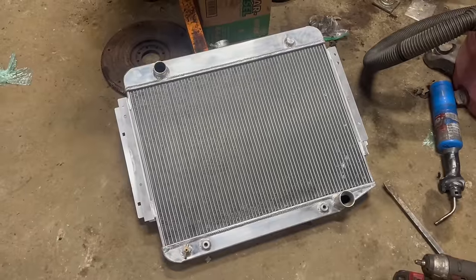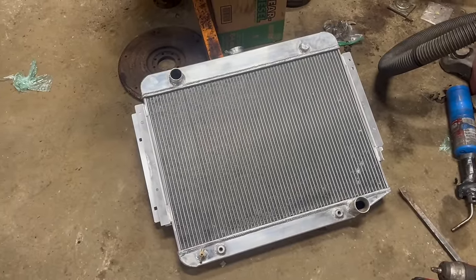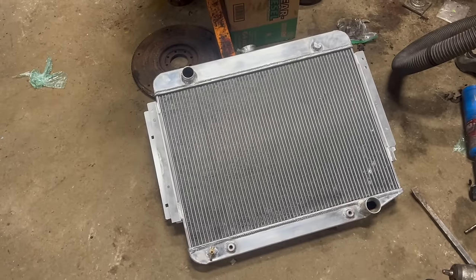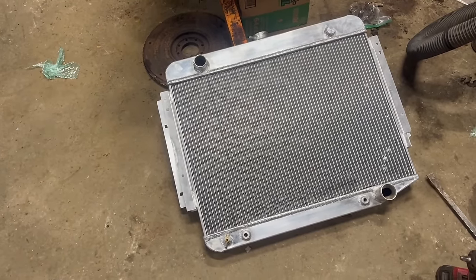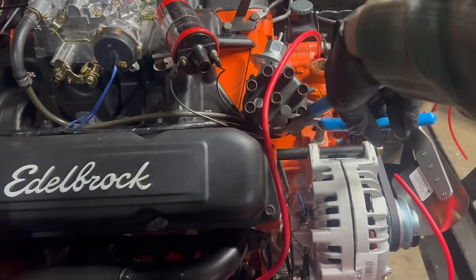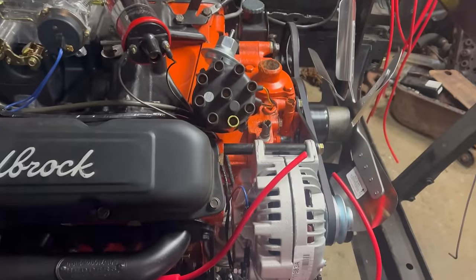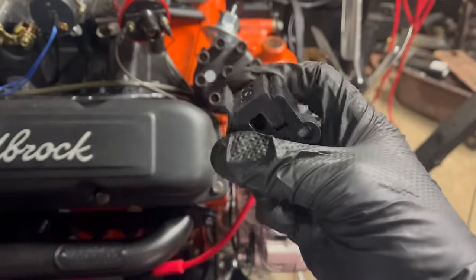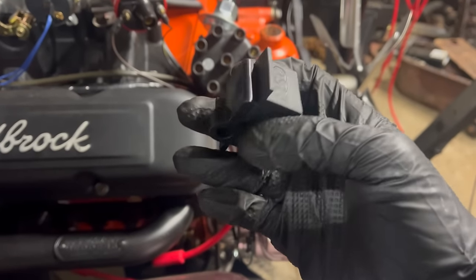There are a handful of small things that need to happen, like vacuum lines and such, but there are two major hurdles. One, I need the transmission cooling lines connected to something, either this, with the correct fittings, or a chunk of rubber hose connecting them together. And two, spark plug wires. Of course, they're the annoying roll your own type, so I had to get the special crimper cutter tool from the local parts store. Now I'm gonna trim these things up and put ends on them.